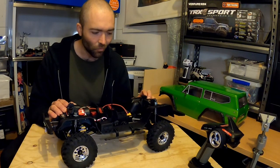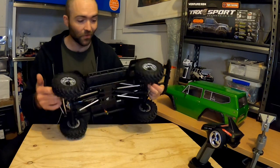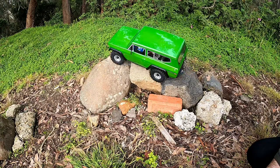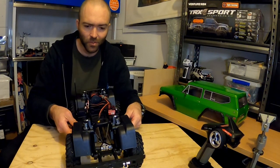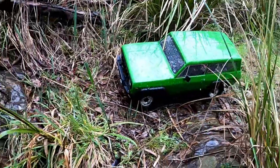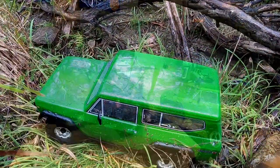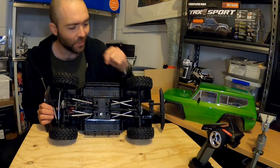But on the rocks, this really surprised me. I love that it's configurable — you've got two mount points for the links, and a really plush suspension. I added some preload during the trail run. One thing that disappointed me was torque twist: it would squat and drive noticeably leaned over when accelerating. I thought portals might decrease that, but they didn't. Having opposite-spinning driveshafts would have definitely helped.